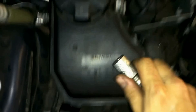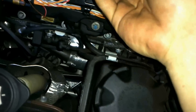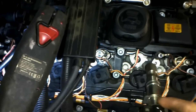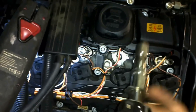Last job — take off your special tools and within five minutes, they're pretty specific, don't leave it out. Chuck the injectors into the hole, push them down, chuck the clamps on, and reinstall everything that we've taken off — and that's it, you've done the injectors on an N54 recall. The torque specs will be posted at the end here for all the different things you're going to put back together, especially the high pressure lines. Catch you next time on BMTroubleU.